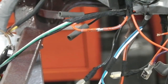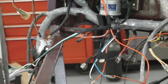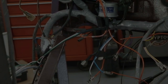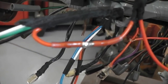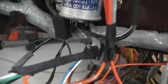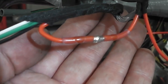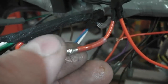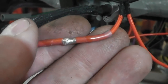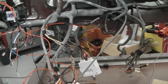Right, let's get you in and have a look. Hopefully you could have just seen what was going on, but we're going to bring you in up close on that hook. Soldered, all in one operation. Still be warm, so I've got to be careful. Look, it shrinks together. Solders all in one. Beautiful, look at that. You could just build looms all day with those type of connectors. Love them.